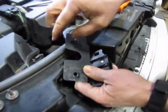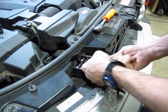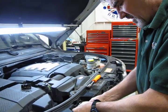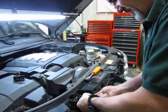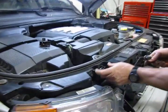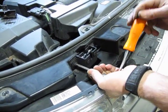We have that back in place. We're going to put our shim back in — remember the shim? The opening faces up. Run one bolt through there first just to hold everything in place, then grab the other. Now because we're putting in a new component, we couldn't mark its location so that we'd end up with the same adjustment we had before taking it apart. You may need to loosen these bolts and change the location of the latch so it latches properly. Start with pretty much a center position — we can go right to left a little bit and up and down. We'll let it start in the full down position. Snug them in but don't lock them down quite yet.